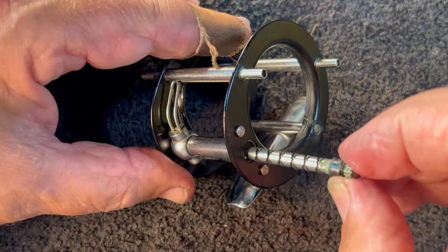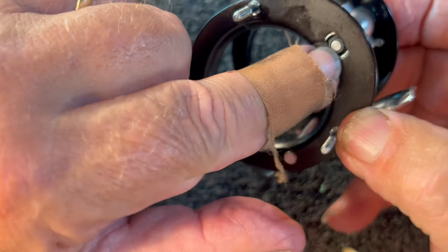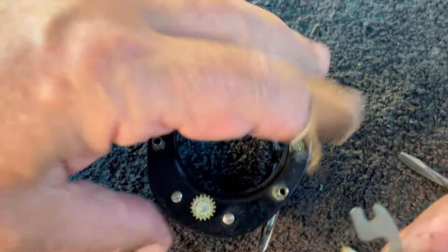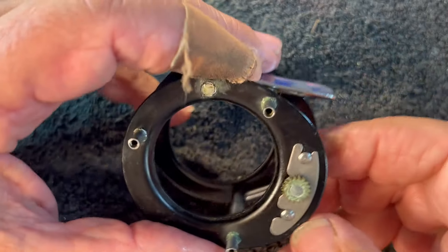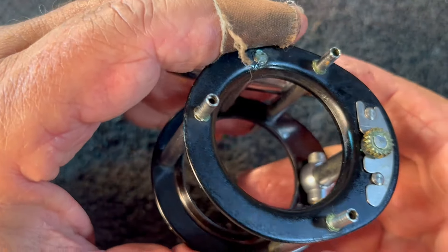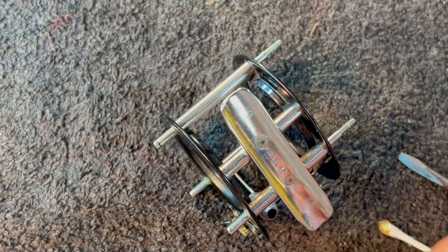We've got to get this in right here, so pull it back out for just a second until we get that installed where it belongs. Let's slide it up this way — that'll help hold it in place while we put the other end in. There we go, now that's installed — it's in the slot up here and it moves freely back and forth. The next part to go in is going to be our worm gear. It's going to slide through and it has to go into that black plastic sleeve on the other side like that. Then we have this assembly which is going to slide in under here, fit through there, and lock back into place — and therein fits our worm gear.